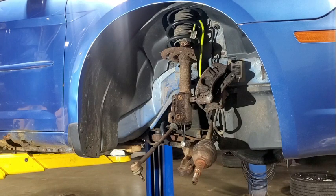Yeah, can't win. The problem is, even if you do a compression test and they have a bad lifter, sometimes you won't even see it. Oh yeah, exactly. I think the only way you're really going to be able to see it is maybe an in-cylinder test. But then you would have to have a known good overlay, and even that's hard to see.